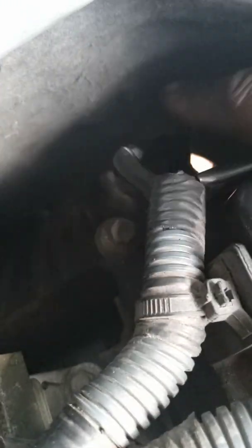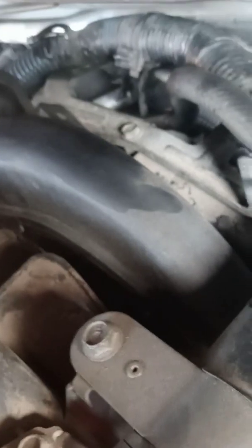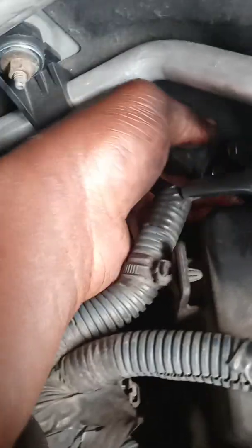The second one — I have to jump on the car — it's right here. You can see the harness goes to it, which is right on here. It's very dark but there's a 10-millimeter bolt; take it out and it should pop out. That is it right there — a 10-millimeter bolt. Take that out, then reach in and pull it out. That is the second one.